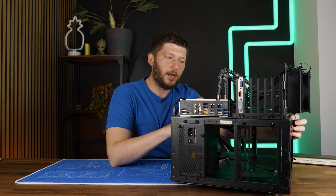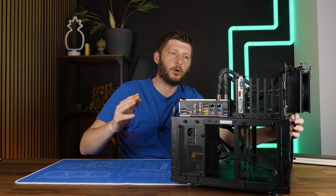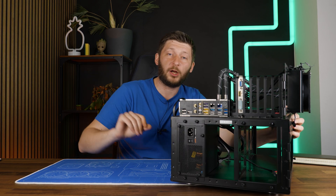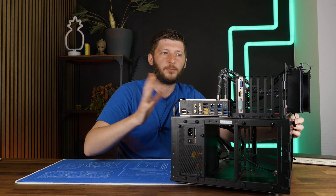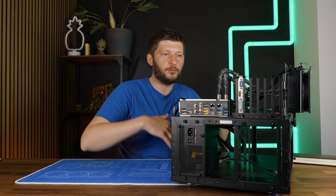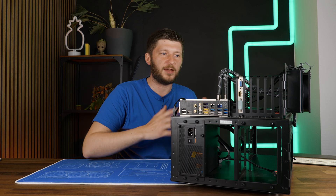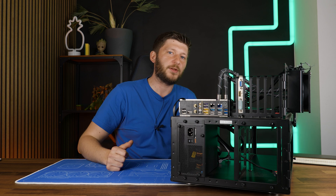When I put this new machine together, my intention was to have three different workloads. I wanted to have roughly 100, roughly 200, and roughly 300 watts — to cover an entry-level CPU, a mid-level CPU, and then the full-blast scenario — and then test every cooler against each of these presets.